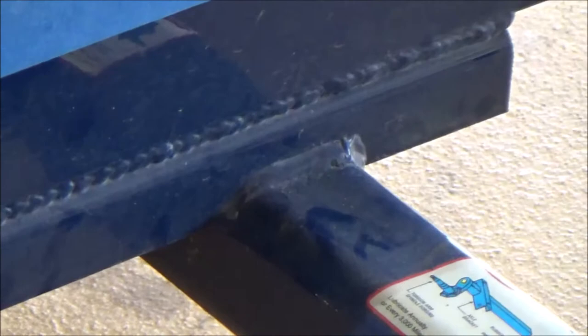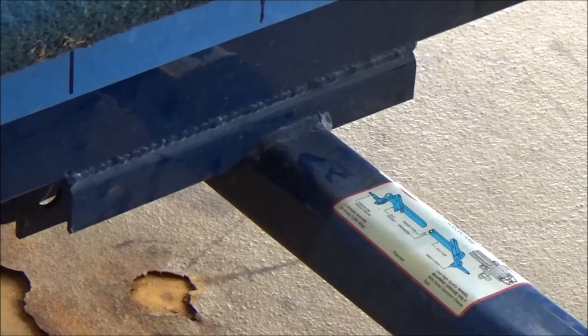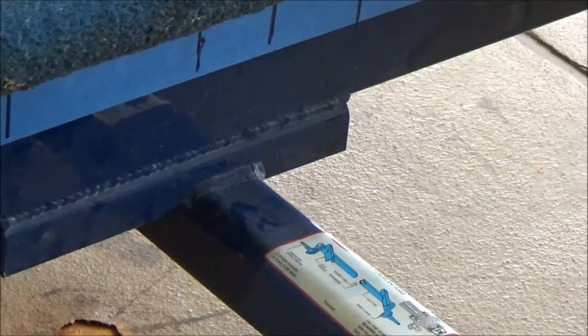Reliable was real helpful when I talked to them. They had the history of supplying these axles to Prestige Trailer, and they told me that when they saw these pictures, they said, oh, okay, you've got the 1-inch mounting bracket, and Prestige had problems because the tolerances were so tight that they later went to a 3-inch mounting bracket, putting an additional 2 inches of lift between that axle and the underside of the frame for the trailer.